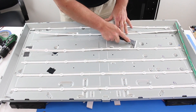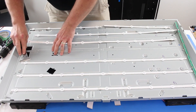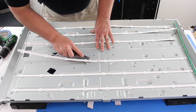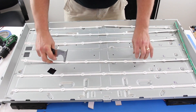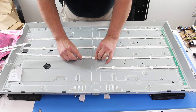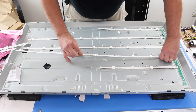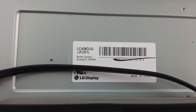If you decide to replace the LEDs in your TV, here are a few recommendations. It is recommended that the replacement be done by a trained professional, as during the replacement process there is a chance you could damage the TV panel — if you damage your TV panel, it is not fixable and your TV will no longer operate as normal. Always replace all of the LED strips in your TV at the same time, since if one has shorted out there is a high likelihood of another having the same problem. When searching for replacement LED strips, be sure to find the panel information for your TV and search using that information. Panel info can be located on a sticker on the panel or sometimes on a buffer board in the TV. LED strips are panel specific and not model specific.